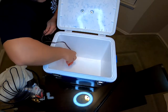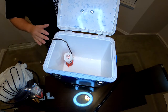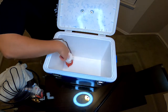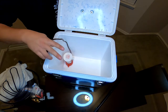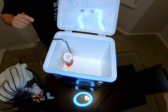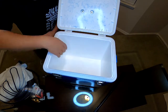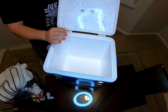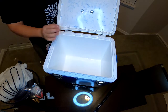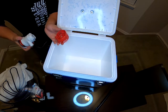So the first thing we're going to go ahead and do is find a good spot inside the cooler to mount the bilge pump. I already know that if I put the pump over on this side, I can run all my water lines over to the opposite end of the cooler, which will then run over to the driver's side of the vehicle. So I'm going to whip up some JB Weld, scuff up the bottom of this mount as well as a little spot on the cooler so we can get the JB Weld to adhere extremely strong, and I'm going to put a couple screws inside this mount as well just to make sure it's not going to go anywhere.